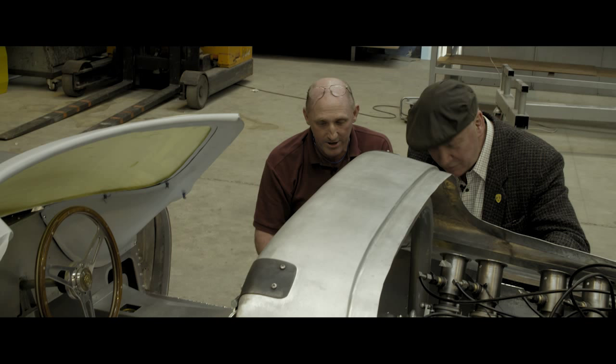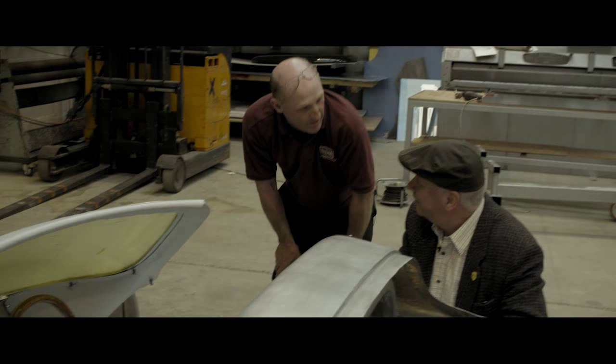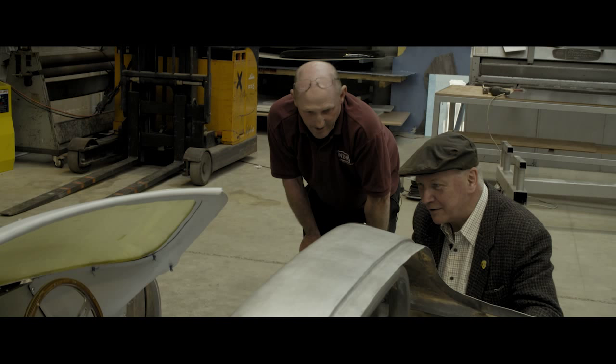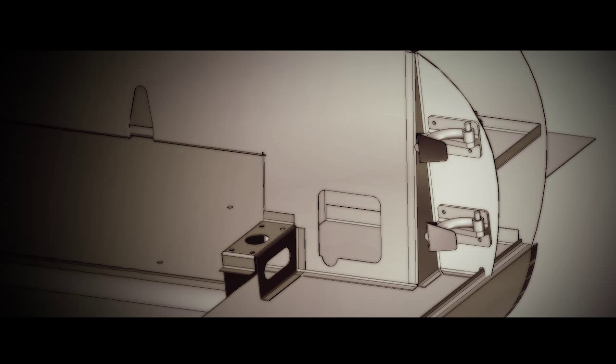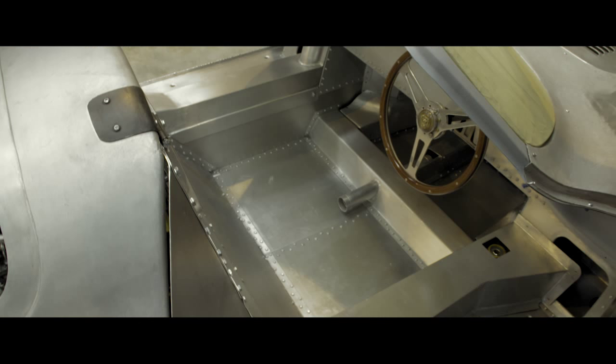You've got the tunnel in for the gear linkage — that's all in now. Fuel tanks? Fuel tanks will be fitted in the sills — as you know, the original was bag tanks, but we're going to put in proper aluminium tanks that can be taken in and out in case of leaks. I think it's a lot safer. And you've replicated all the hinge detail? All the hinge detail — Paul's drawn all that up on CAD and they're fitted quite nicely. I see you've done the floor as well — it's ever so strong if you stand on it.